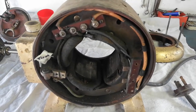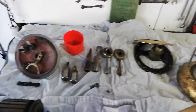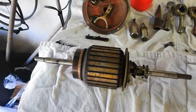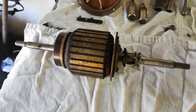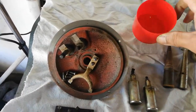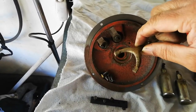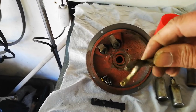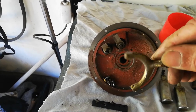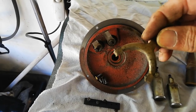At the same time I get a chance to clean all the bits and pieces. There's the armature there, that needs to be cleaned up. There are two brushes in here and parts of the switch to change the speeds - this one looks like it's been broken off or worn out, so I have to come up with something to get that fixed.